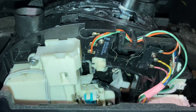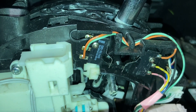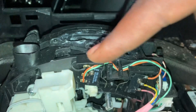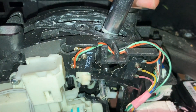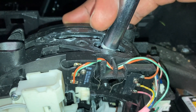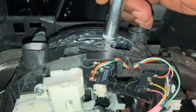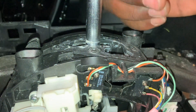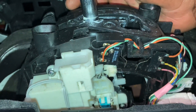It's pretty interesting. So all the way to the end, nothing magical happens over here. It's just those contact switches — plus, plus, plus, minus, minus. You can actually wire them backwards if you wanted to, so that your plus would be at the bottom and minus at the top. But then back out this way so that, as you can see, the rod that was touching it — this rod over here — is now out of the way. You can always go from drive to neutral with no obstacles, from neutral to reverse do that. You can slip backwards but you can't go forwards. You can slip from reverse into neutral, but you cannot slip from neutral into reverse.